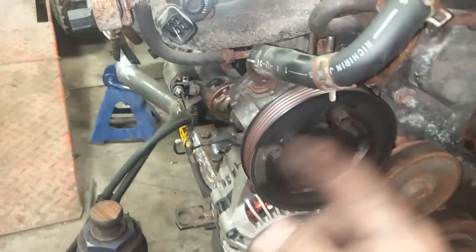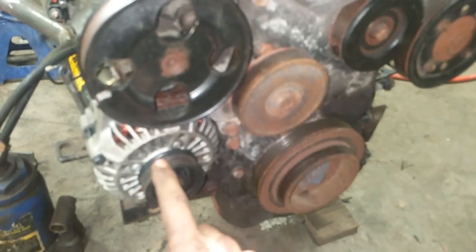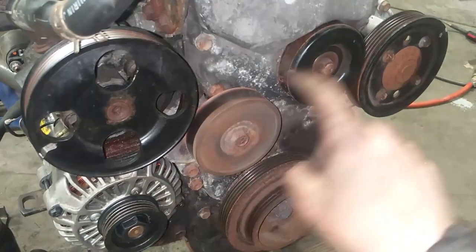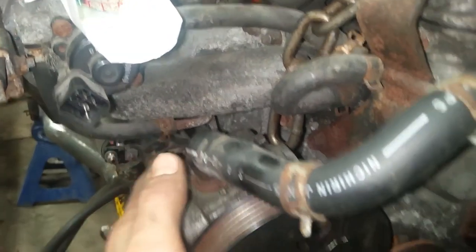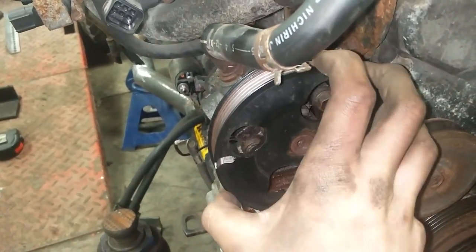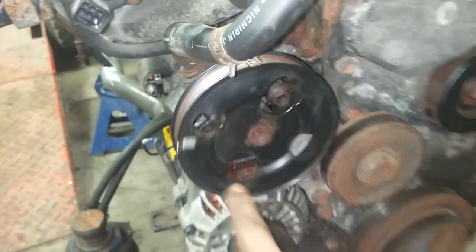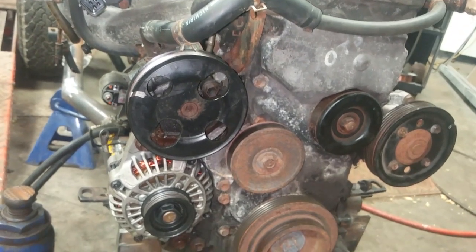We're gonna get rid of this and I'm gonna try and find a belt without having to have an idler here. Because when I make a new log manifold it's gonna come down like this, and the intake is basically gonna be right where this pulley is — that's where the end of the throttle body is gonna go. We still have to hook up the MAF, which is on the car, and it's gonna take up space. I'm really just trying to keep this as short as possible — I'm already kind of upset with how long it turned out.